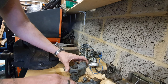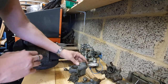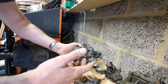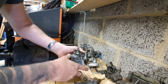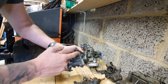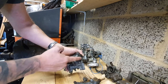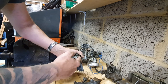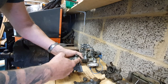There's another video about how these carbs actually work. You've got your choke there, which is a fuel enrichment device. When it's fully off it's not letting any fuel through, and when it's fully choked it's over in that direction. If it's bogging down, putting out black smoke at idle, or struggling a little bit, that could be choke-related.